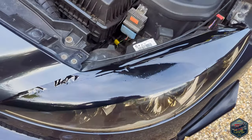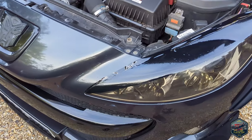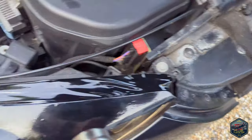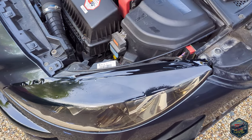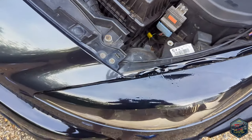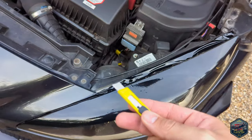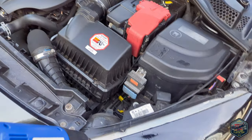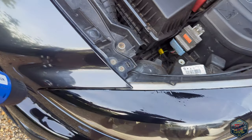I've almost done it — it's not perfect, I've got as many bubbles out as I can, but there are still going to be a few because this isn't the style of vinyl that has the anti-air-bubble backing, but I'm working with what I've got. When you come to the edges, heat them right up so the vinyl falls into the gap, and then we're going to cut the edges off so it's perfect. As you can see, once heated it drops right into the edge. Cut the excess off with a blade — I just use a cheap little blade, really sharp, really cheap. Then once you've cut the edges off, go along them with the heat gun just so they all stick to the edge of the light.